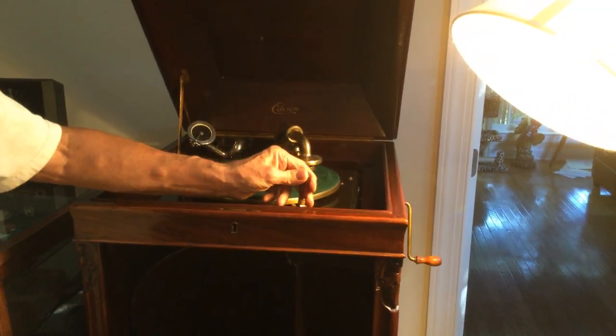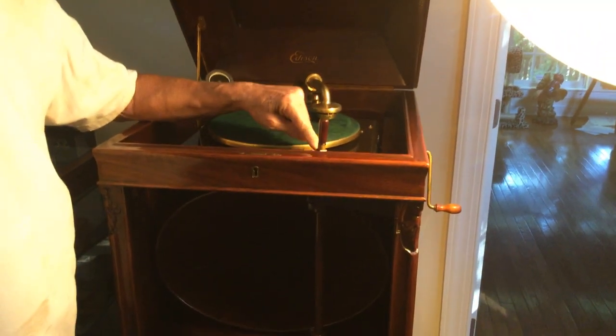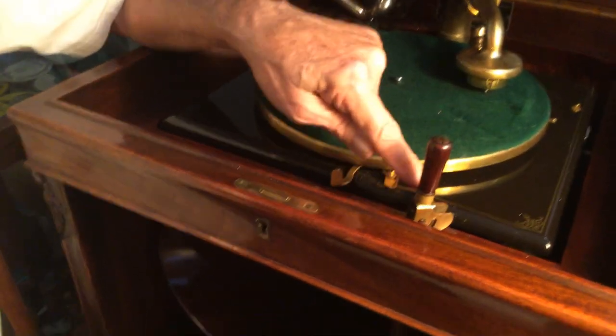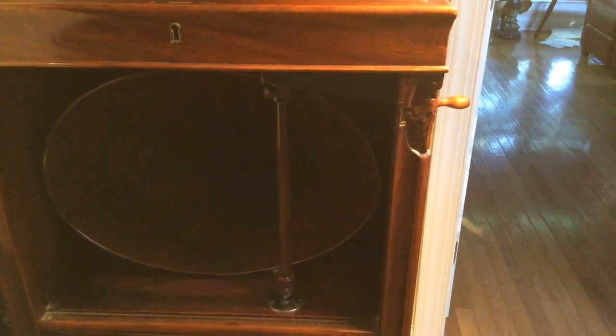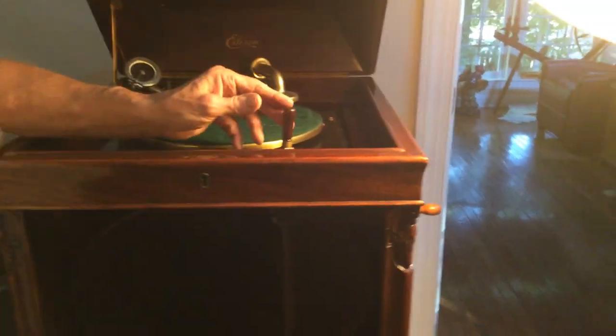You're going to drop this down — it's tight here. And if the lift lever is not touching the automatic brake piece here, when you lift it up it's not touching, it might be a little high. You want to undo the screws back under here, loosen it up, and just take the palm of your hand and give it a little hit, and that'll pop it down. Tighten everything up — that's really simple.